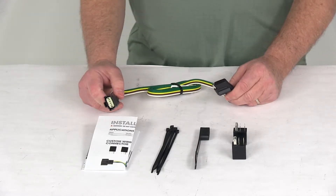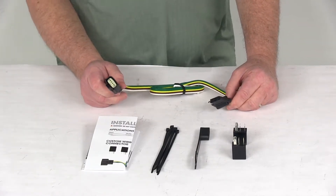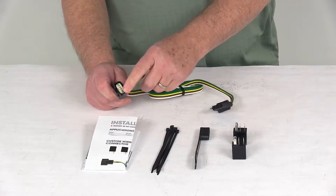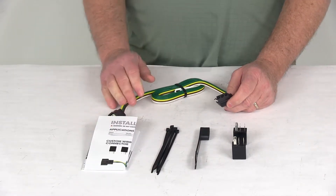This connects very quickly and easily — there's no cutting or splicing wires. You just locate your connection point, which is behind the rear tire along the frame rail, plug in the connector that matches up to the one on the vehicle, and then route the four-way to the center of your vehicle and out of the trunk.